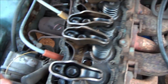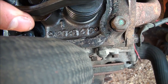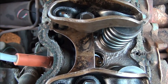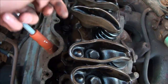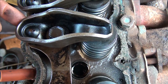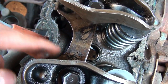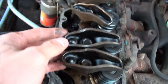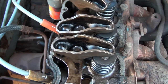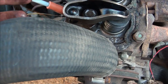You can see it's actually a bit bad. It smells like fuel and oil. What I hate about taking these covers off when nobody's touched them for years is the fact that someone has used silicone to put the gasket on and the gasket is broken now - so that's great. Anyway, it doesn't really matter. These are supposed to have a little bit of play, but see - seized up. That one has play, that one's broken, that one's broken. They were getting oil, it was pressurizing, but you can see some of these brackets were bending - so they are having not a good time. It's telling me either my lifter is stuck or something else is seized, so once I get that off I'll know the problem.